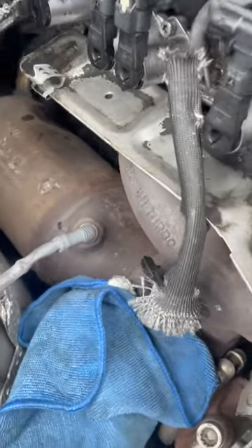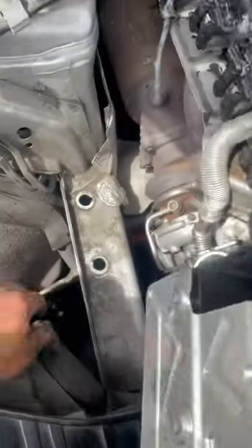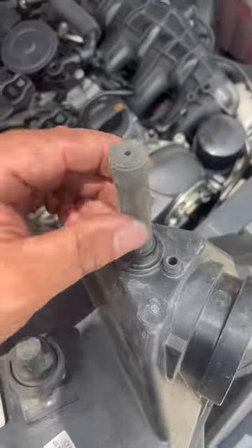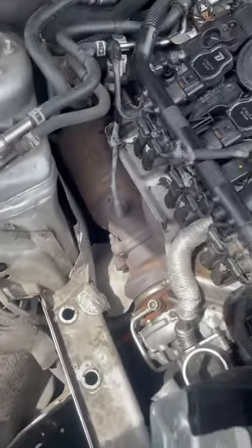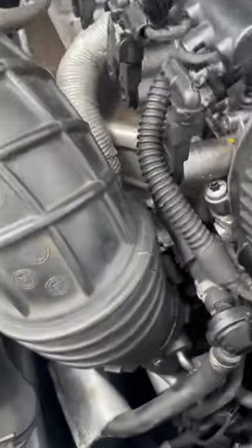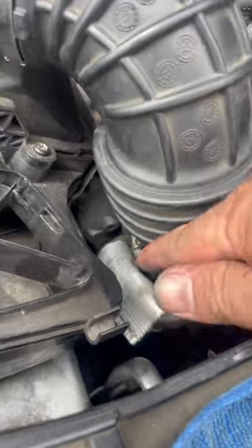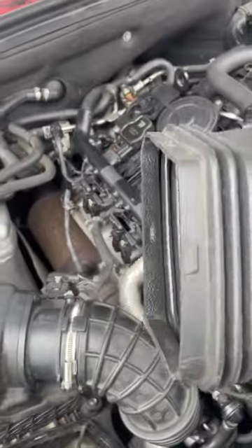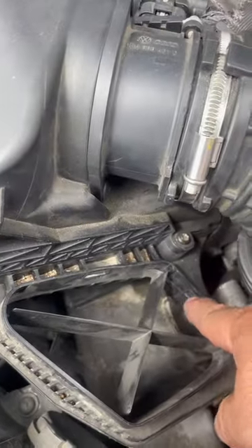This goes to your MAF once we put the air filter in there — that's where the air filter's at. These two little rubber rivets go in those two holes. Your drain hose is going to sit around here. Air filter installed. Intake boot tightened. MAF sensor connected. Got to get these clips onto these slots in here.